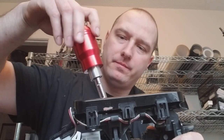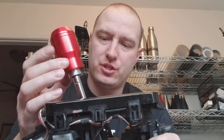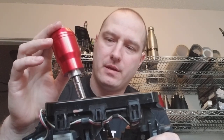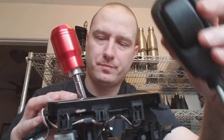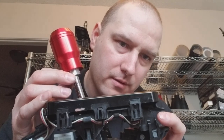The way it's designed is the weight of the shift knob pushes down onto that sensor. If I pull the shift knob up you should be able to hear that button click, which it does. The weight of the shifter is pushing down that sensor just that little bit and holding it in place. With the stock one, there was a little clip in there that held it all the way down — in my design it's the weight of the shift knob that holds it down.